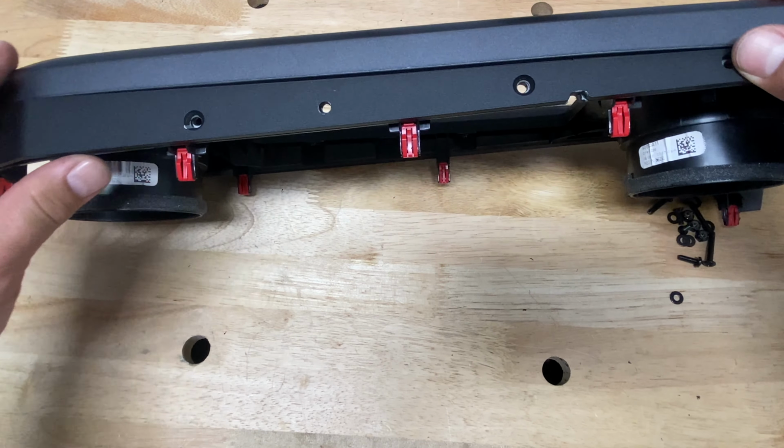Now I'm gonna go ahead and strip back the provided cable about 1/4 inch. We're gonna tap into our power source using these posi taps. Now the posi tap is three parts: a central body with an internal metal conductor and a tap probe, a hollow end collar, and a U-shaped saddle collar. To use a posi tap, just secure the wire being tapped into the U-shaped saddle collar and screw the central body tight in place. And my power source is gonna be this purple wire.